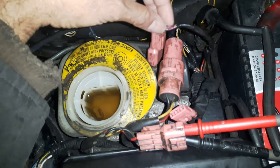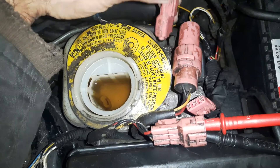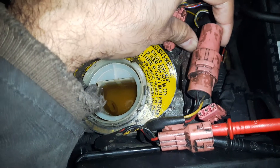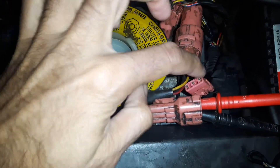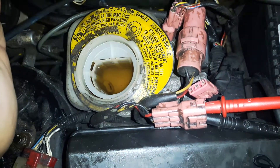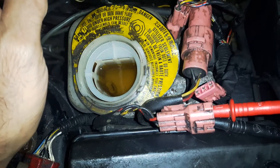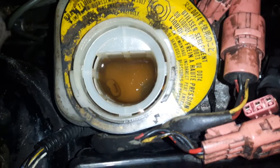These are the connectors near the secondary reservoir for the solenoids. This one is for front left, this one is for both rear, and this one — already opened — is for front right. If you have rear independent suspension, you'll have two connectors like this, so altogether four connectors for four wheels. The solenoids are right inside underneath.